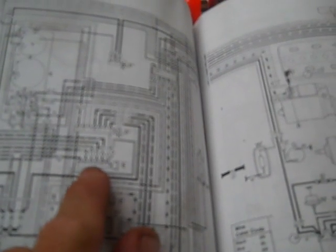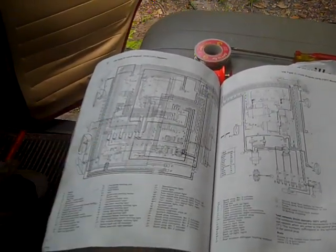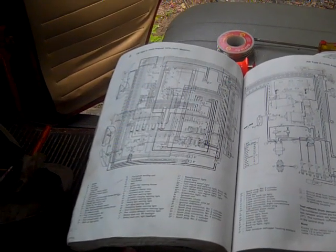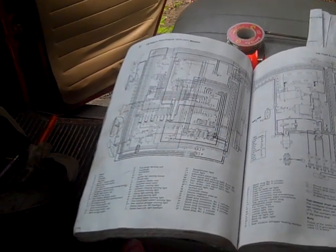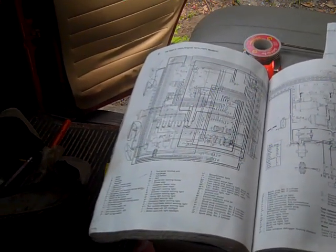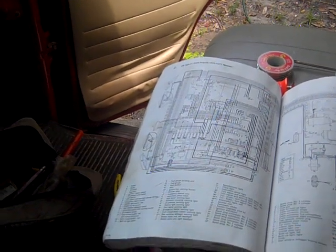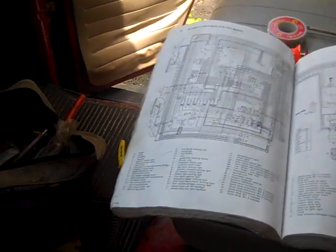Like my headlight switch — it's supposed to be labeled 30, 53A, 31B, 53, with numbers for where each individual wire goes. When I pulled the new headlight switch out and compared it to the old one, the old one had different numbers; some things were plugged into numbers that didn't sound right. I tried to use the Bentley's to see which other years it came from, but eventually just gave up and said, 'Obviously it's the wrong one — that's probably why it burned out.' It's definitely worth going through your stuff yourself because you'll find things you didn't expect, things you may start to recognize and can fix before they become problems.